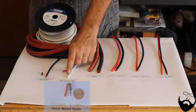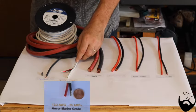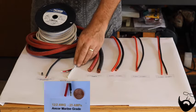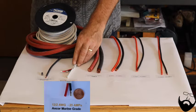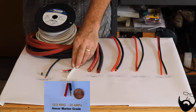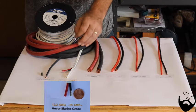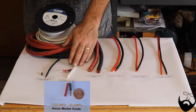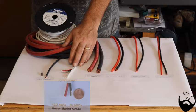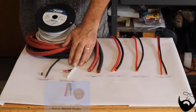This 12-2 gauge wire — which means two conductors of 12 gauge each in the same wire — is a marine grade wire from Ancor. It's a high quality wire that you can use for all of the 12-volt applications in your van. Anytime you're buying wire for your van, look for marine grade, because marine grade wire and components have to endure a lot of water and a lot of vibration. You're going to have moisture from humidity in your van, and when that van's driving down the road, it's like a little earthquake.